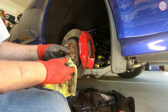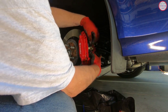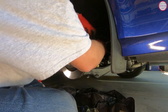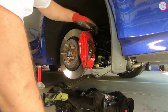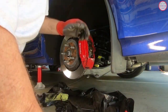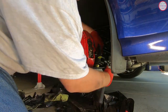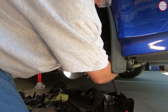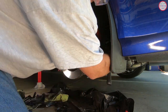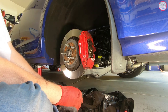Cleaning the pins and spring clip before reinstalling. Getting the lower pin started with the spring clip underneath, then putting the top pin in and pushing the spring down to get it through. Using the hammer and metal punch to pound them back in. On the rear calipers, the pins push through further than on the front calipers. It takes a little tapping to get it right. With that, front and rear are done — repeat on the other side.